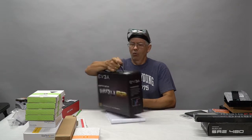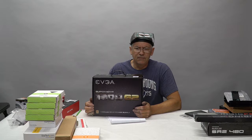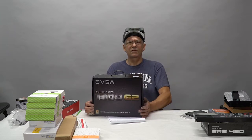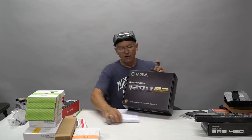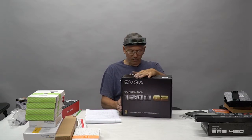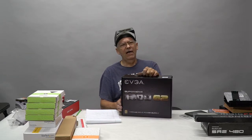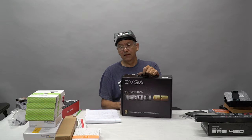Now, to power all this, because we're going to overclock your CPU, and we've got 2 GPUs running, we're going to be banging this thing out at a pretty substantial amount of watts. We're probably going to be pulling somewhere around 700 to 750 watts under load. So there's no kill like overkill. This is a really great power supply. It's a 1300 watt EVGA rated gold power supply. It also has an eco fan setting so that the fan on this power supply will not kick in unless it needs it, and in most cases with the load we're putting in, it won't need it.